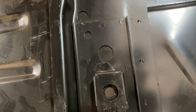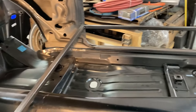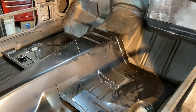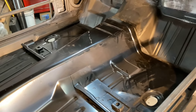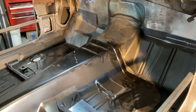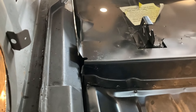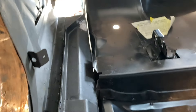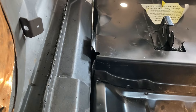My bolt for the subframe is perfectly lined up — jig perfectly lined up. That's called extreme confidence. I don't even have to second guess it; everything is where it should be. Now that the floor is in place I can step back and admire the handiwork — instant gratification. I've been staring at rust for so long, and to see the final brand new full floor up against beautiful new rockers puts a smile on a guy's face. Checking all the various tolerances — back here at the rear of the passenger floorboard near the seat bracket and torque box, it's sitting a little high. The bottom of the floor isn't lined up with the bottom of the rocker panel, so it's telling me it needs to come down.